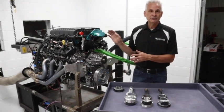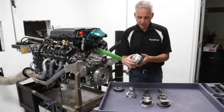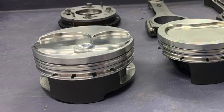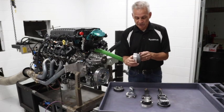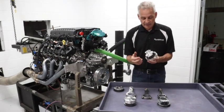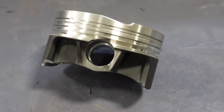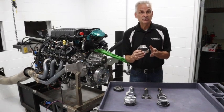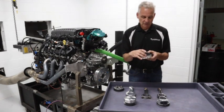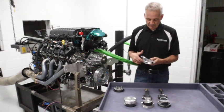If you want to go beyond that, what we have in this engine — where we're trying to make as much power as possible with stock cylinder head castings — is another Wiseco piston designed for about 12.5-to-1 compression, giving adequate valve clearance for the 900-lift Charlie Westcott cam we have in it. One important thing I didn't mention: this is set up for a .990 pin, a standard off-the-shelf pin size. It's slightly different from the standard 7.3 pin, but there are so many .990 pins available that it made sense — if you're putting in an aftermarket rod and piston, go with the off-the-shelf part to keep costs down and availability up.